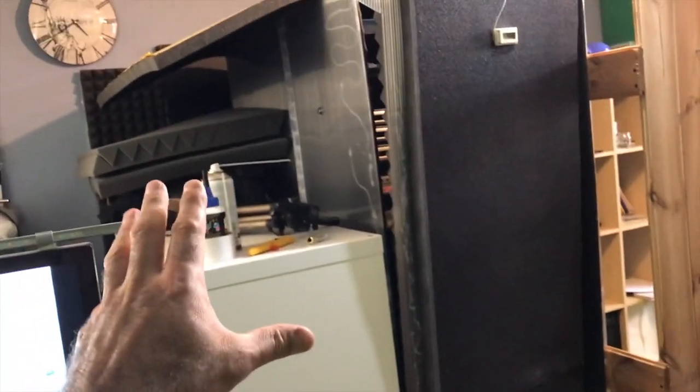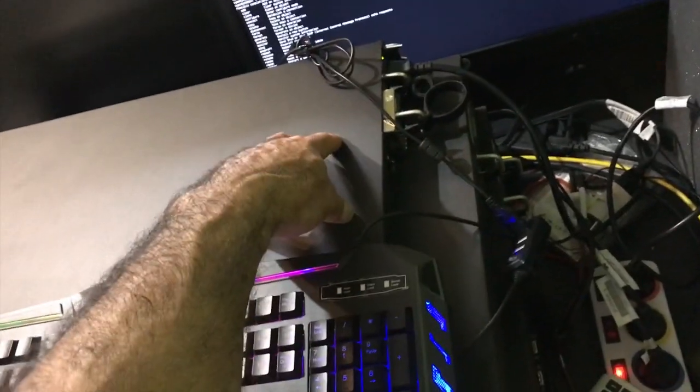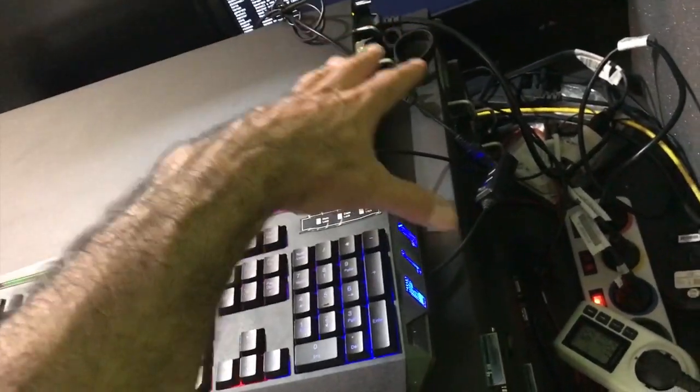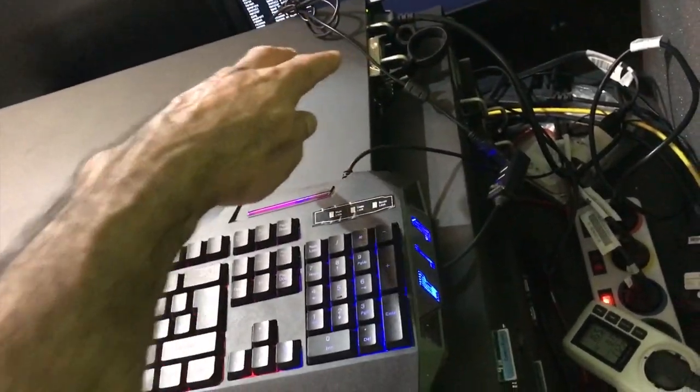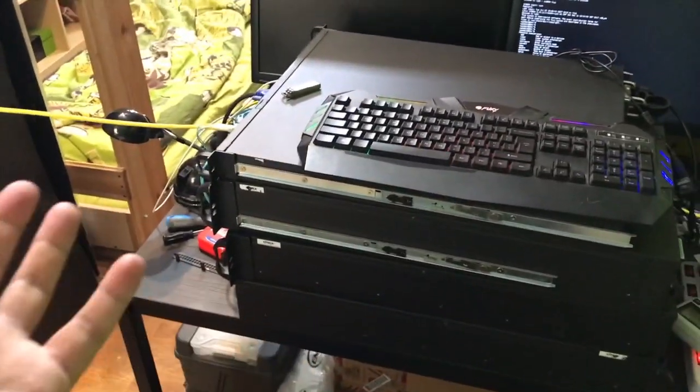Of course, I'm going to put that into my rack, and I've got sound absorption material everywhere to try to help with that. So it's going to be relatively quiet. The other thing is, because if you get a 7500, you've got the dual power supplies. So that's going to be making this more reliable, if you have a main power and maybe a backup power to keep the switch going. If the switch goes down, your whole network goes down, right? Especially if you're doing server-to-server transfers and stuff like that.